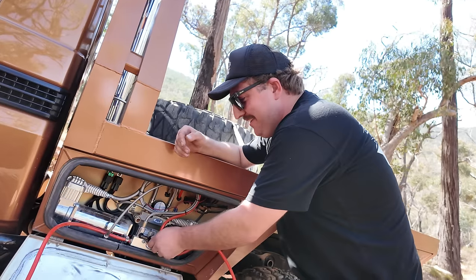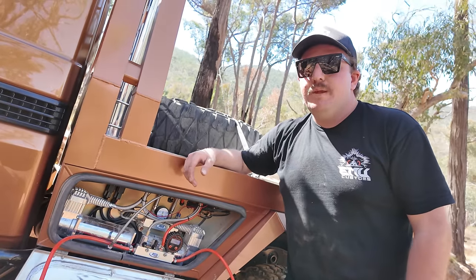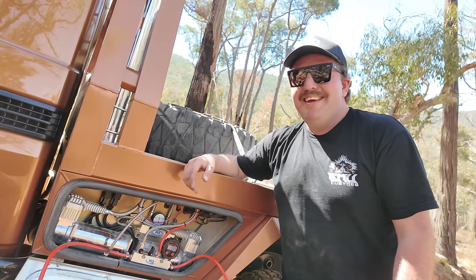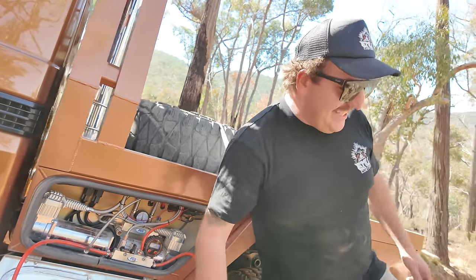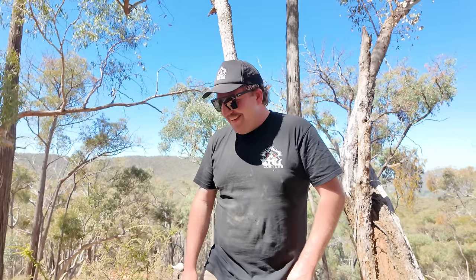Now that that's stopped, that one lets them down. So you're deflating all four tyres at the moment simultaneously, while just standing back and making a YouTube video. So I can actually now just do whatever I want and all four of my tyres let themselves down. And it's just the same when I go to air them back up, but it takes a bit longer. There's nothing worse than sitting there having to maintain each tyre, squatting down, looking at pressures.